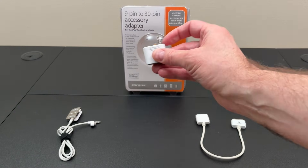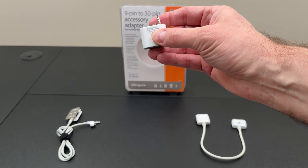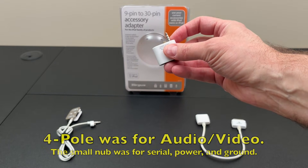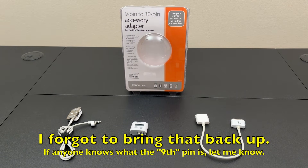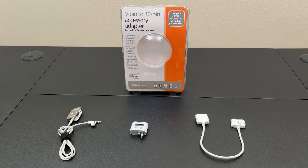This connector is a combination of a four-pole audio jack — not the standard four-pole TRRS jack we use today — and a little nub that has connectors on both sides. Collectively they're known as the remote port connector, or sometimes the nine-pin connector. This came out in 2003 with the third generation iPod and was also present on the mini, the fourth gen iPod, and the iPod photo, before being discontinued in 2005 with the first gen nano and the fifth gen video iPod. Accessories included mostly wired and wireless remote controls, FM transmitters, and microphones — the market wasn't that big.